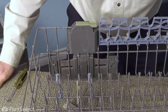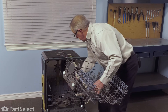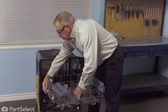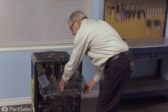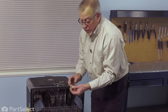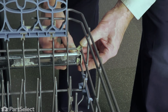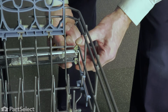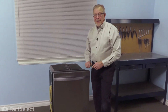Now that it's locked in place, we can go ahead and put the rack back in the dishwasher. To reinstall the rack, we're simply going to open the door completely, pull both rails all the way out, and then line up both rear wheels. Slide the rack in to engage the front ones. Once we have it pushed back all the way, we can then reinstall our rack stops — slide that lower tab in first, line up the top, and make sure that that little locking tab is retracted enough to hold it in place. We can close the dishwasher back up and our repair is complete.